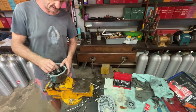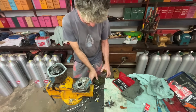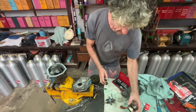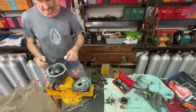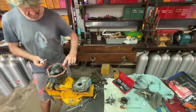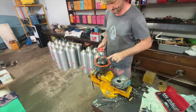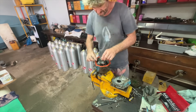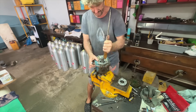There you go - that wasn't too hard. Thought you weren't going to get it, and look - it's all back together and spinning. Now we're pretty much ready to put the casings back together. One big tip before you do this: have a thorough check around the bench, under your tools, under your rags - make sure there are no leftover internal pieces. Very, very important. Next up is some gasket glue - RTV will probably do, the gearbox temperature shouldn't go over 100 degrees. Do a good bead and flatten it with your finger for good coverage of the whole thing, then drop the casing on top and press it down evenly.